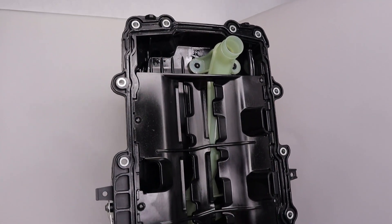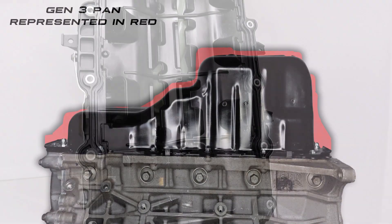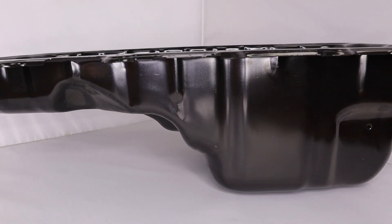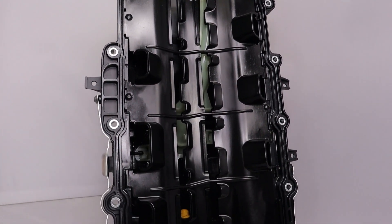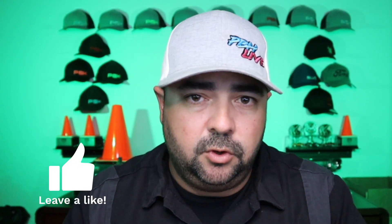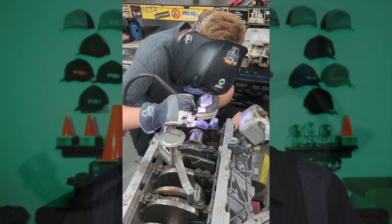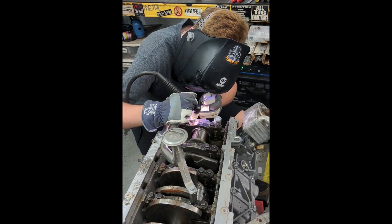The composite oil pan, although giving you extra capacity, does take extra space, and that space is at a premium in most of these engine bays we're doing swaps into. The options are to get rid of that composite oil pan and put an aftermarket piece in, but now with this whole kit from PBH you can also opt to put in an earlier OEM oil pan. What Ford did in this composite design is they put the windage tray and the pickup tube in the oil pan as one piece. When we go to convert it to the earlier Gen 1/Gen 2 version, the pieces aren't the same — even the oil pump is unique to Gen 3. Literally the pickup tube that you need has to be a custom piece; it's not going to be an OEM item.